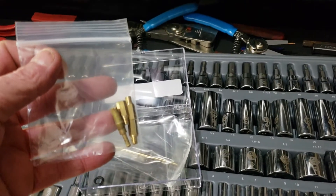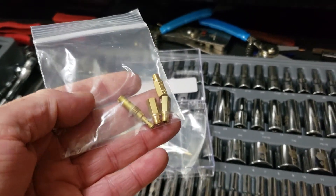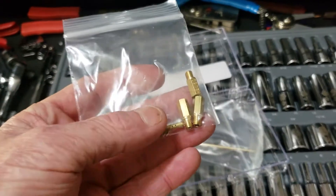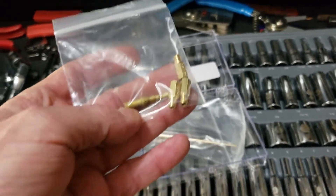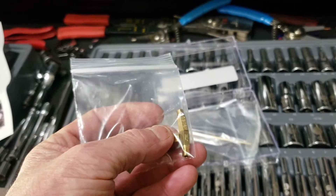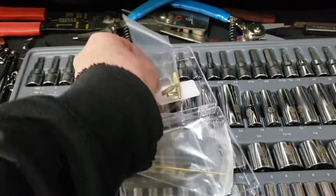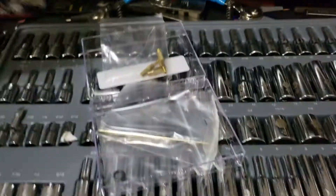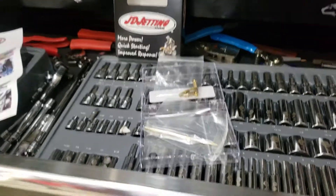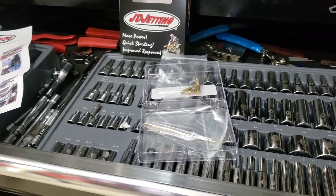The kit comes with your pilot jet. The stock pilot jet in there was a 40 — we changed that out to a 42. Some YouTube guys were saying 160 to 165 jetting, but from what I understand that's mostly for higher altitudes. We're pretty much at sea level. I set this bike for sea level to 4,000 feet, so I went with the 158 main jet and the 42 pilot — exactly what the JD Jetting directions told me to do.